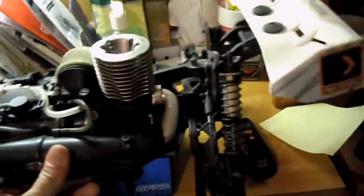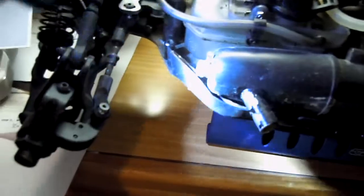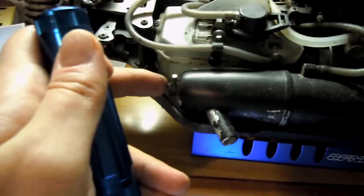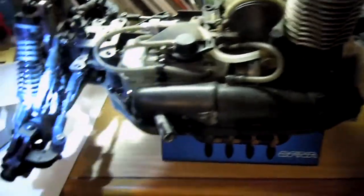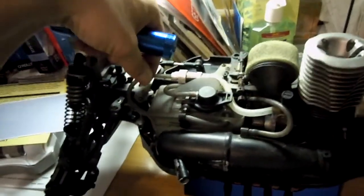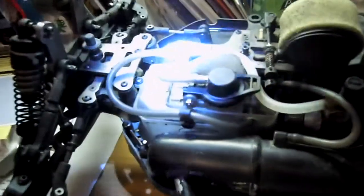One of the things I had to do here is I had to tap a screw, a slightly larger screw. My dad helped me tap a thread to keep this from coming out because this came out and stripped out. So we basically went to the hardware store, bought a tap, and that's held up pretty well. So you can see just the muffler mount, the pipe mount. I trimmed the stock fuel lines and put my own fuel lines in and put a fuel filter in there.